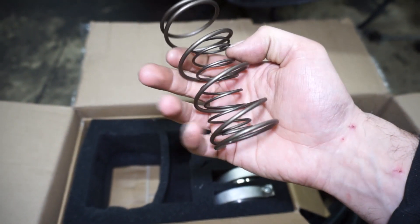I got the driver's side piece notched out. The blue piece is basically just a marker for where I want to cut the bottom of this tube off so I can get the pipe to come straight back down. This is going to come out this way and then a little addition going straight back down. This piece turned out really well — it was almost an accident how well it went together. So next I'll mock these up where I want them from the bottom side, mark where I need to make a hole on both, pull the pipes off, make the hole, and get to welding them on.